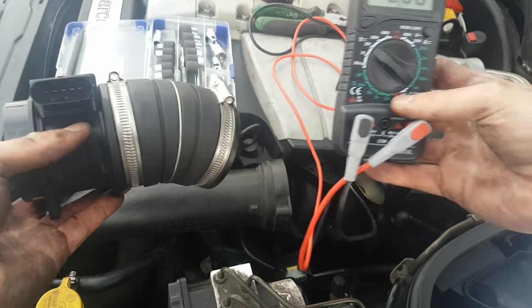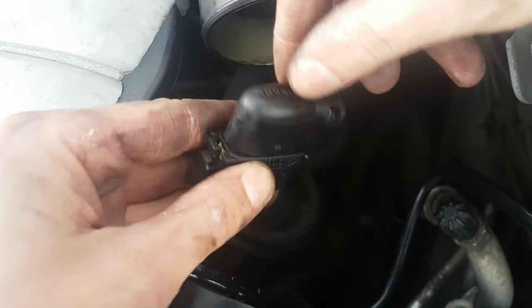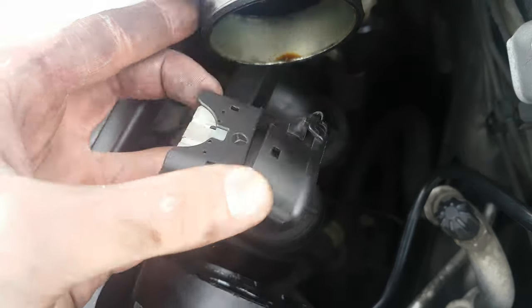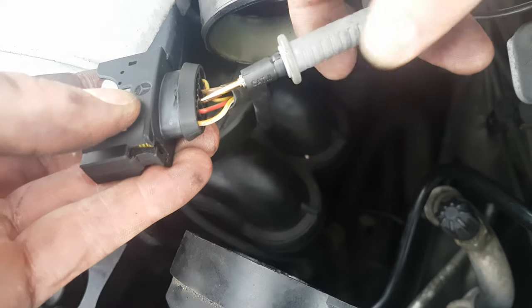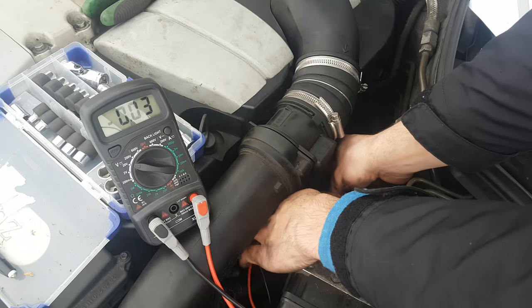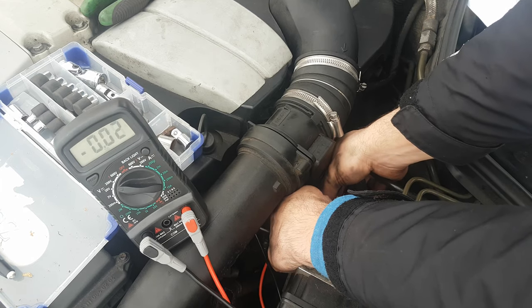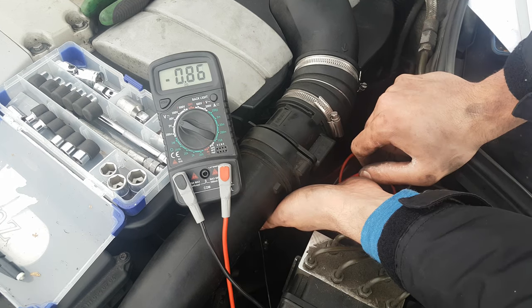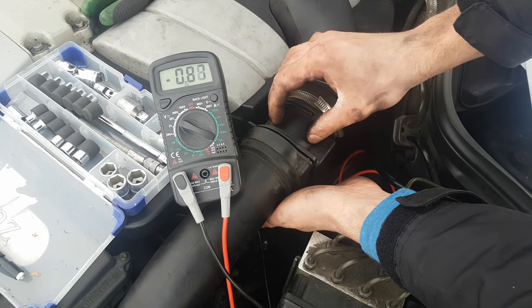With that being said, let's see how you can test this with a multimeter. If you have a look at the connector, you will see that the ends of the wires are protected by a plastic cover — just remove this cover so you can insert your probes into the connector. You've got the numbers here as well. When you turn the key to the second position, you have to measure 5 volts on the sensor wire. Now if I rev up the engine, you will see an increase in voltage demand in order to keep the hot wire at the correct temperature.